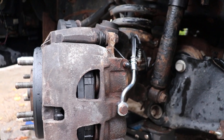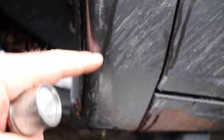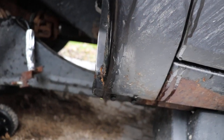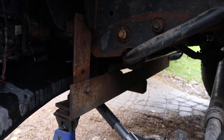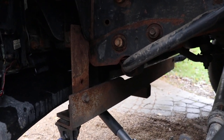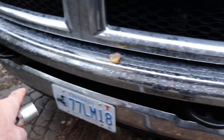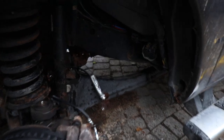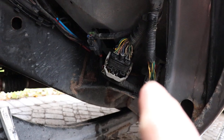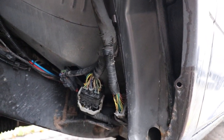Hopefully I pick up a little bit of mileage. With the liner out, there's going to be about a dozen 8mm sheet metal screws holding the liner in, plus a small piece that protects the vehicle. There are also a couple of big electrical connectors under the wheel covers, so it's super important that you take care of your wheel liners — otherwise you're going to destroy your wiring.